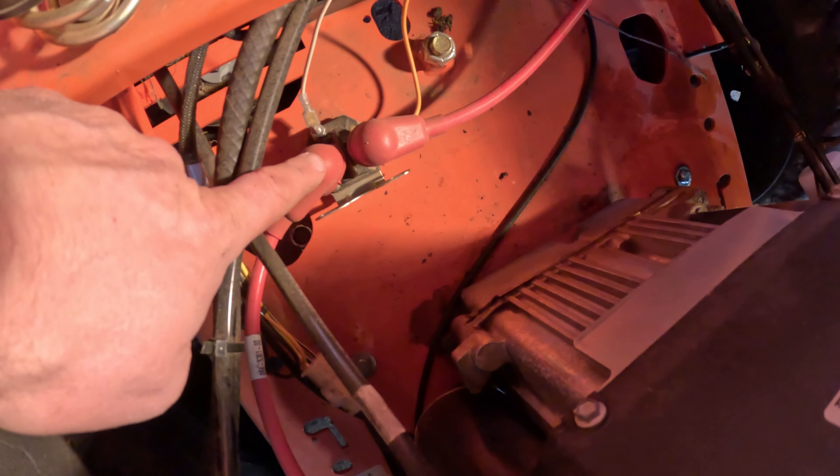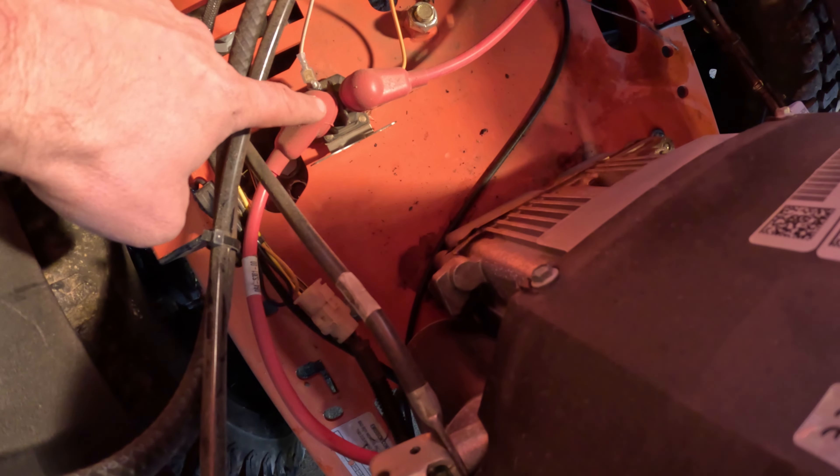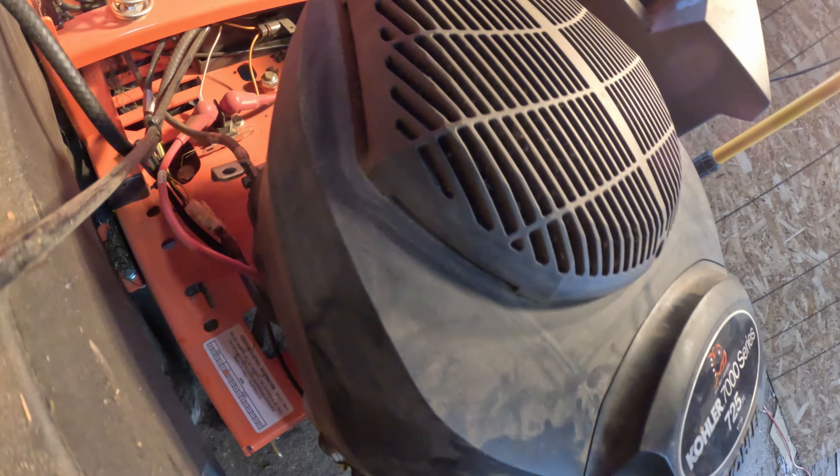Follow your wires around. Here's your starter solenoid — everybody always tells me their starter solenoid is bad, it's never bad. Follow this connection, make sure the connections under these boots are good, then get into your starter right under here — it's a big black cylindrical thing with a wire going to it. Make sure that connection is good. I can almost categorically guarantee you it's not your starter and it's not your starter solenoid — it's your battery. People always want to put a new spark plug in the machine — feel free, but it's not your spark plug. If your machine was running fine, you parked it, and now it won't start — the battery's dead.